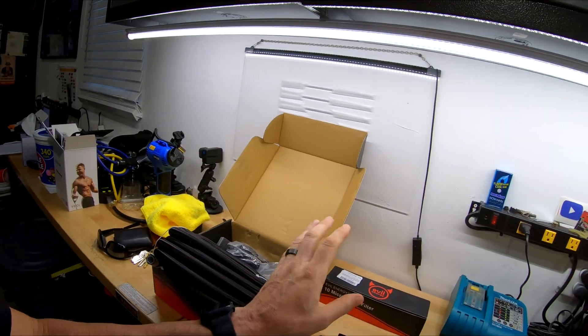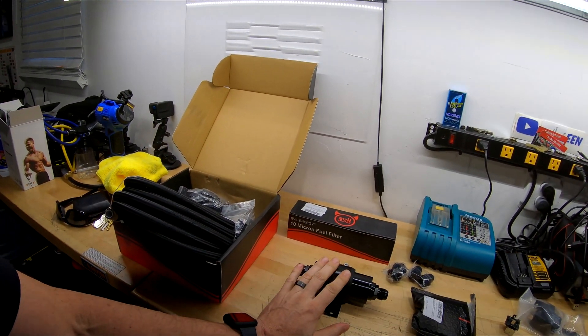It's gonna help with the volume and the pressure. What I think's happening could be a couple of things. One is I just can't get enough volume to the front — that's what's causing the loss of pressure. Two, I feel like it could be drawing more voltage, and with the pumps at lower voltage they're not gonna pump as hard. For example, if there are 13 volts to the pumps they're gonna pump a lot more volume than at 11-12 volts. I've verified my alternator is good, but I may have to figure out if something is dropping the voltage. For now I'm addressing the elephant in the room — a bigger feed line and a stainless steel filter just for E85.